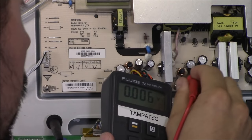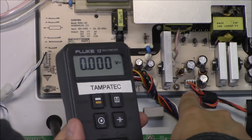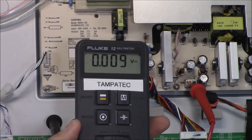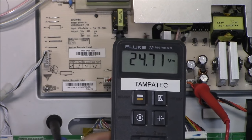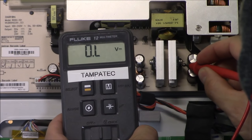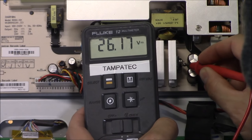Next, let's read the 24 volt line. This is the 24 volt line and it goes to the audio board. On some TVs the 24 volt line may be for the T-CON board or the inverter board, but in this Vizio TV it's for the audio board. This line reads zero volts because the TV is off. After hitting the power button, we now have 24 volts and it's steady. If it was jumping around, I would check the 24 volt voltage regulator. Checking the regulator, I'm reading 26.17 volts — it's doing its job, pretty close to 24 volts.